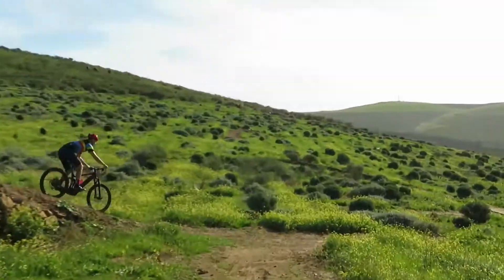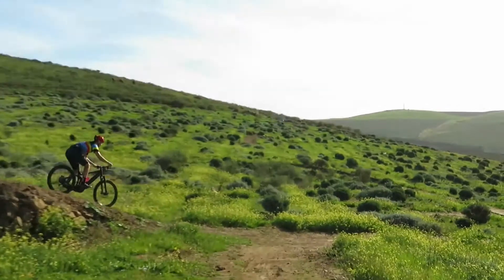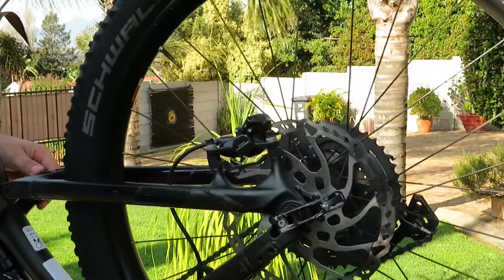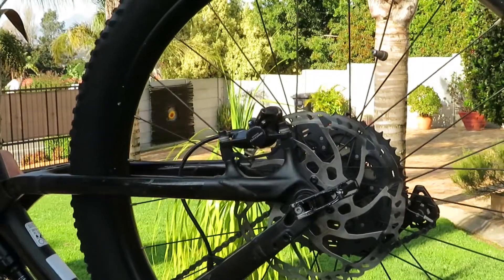Sometimes this doesn't work first try, so if it didn't work for you, just give it a second or third try and it will definitely work. To test that your brakes are perfectly centered, give your wheel a slight push forward. When it comes to a stop, if it starts to spin slightly back, you know there is absolutely no resistance.